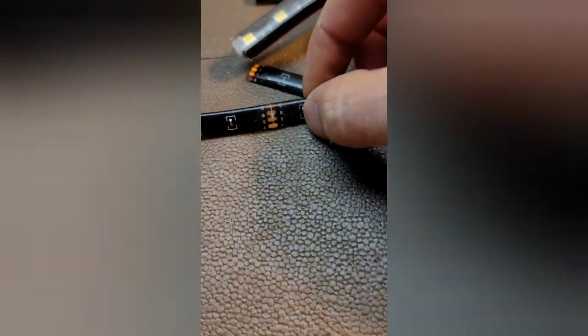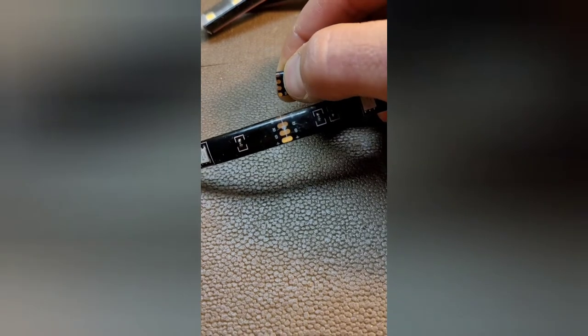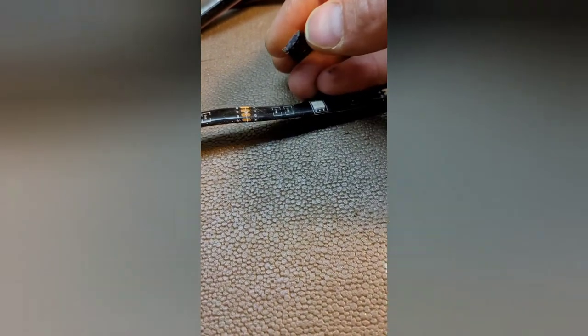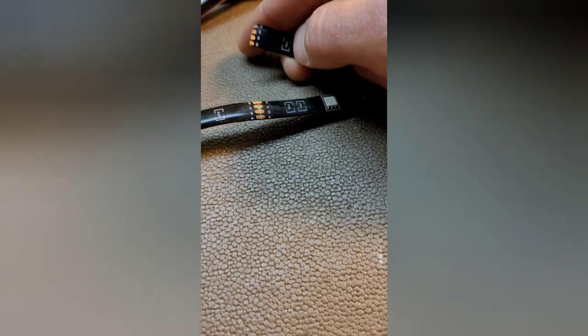For those of you that actually stuck around for this whole video, I'm gonna show you the trick to wiring up those multicolored LEDs. This is just silicone covered, so when you cut it you can't really get to the contacts. If you take a razor and just barely cut down, then cut right above the strip, work on the edge and go through that way — you can get to those copper pieces. They're a lot easier to wire up because they're sealed, so you don't get any of the corrosion. That's your extra tip — thank you for watching!